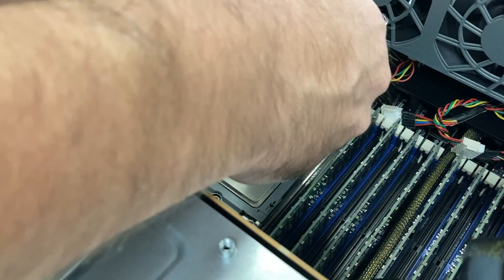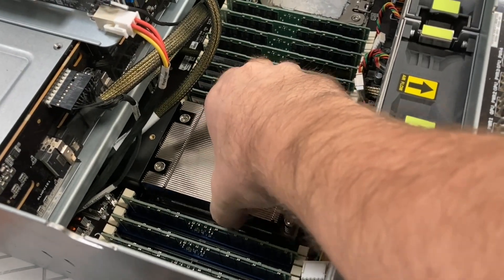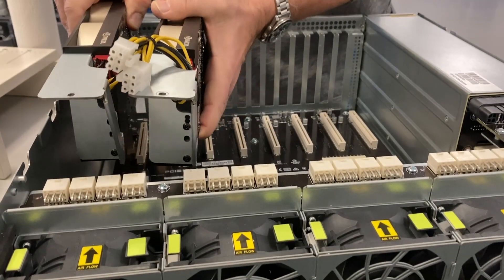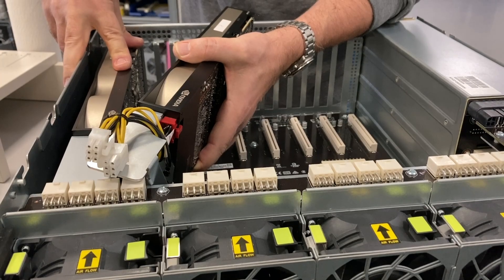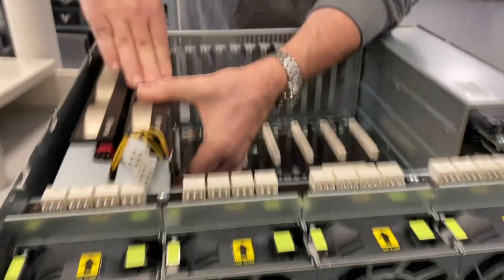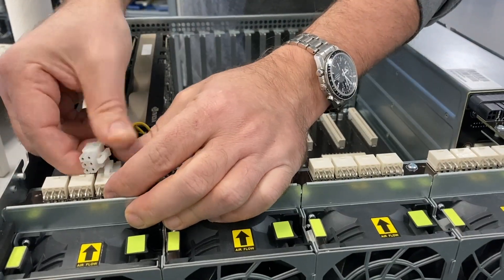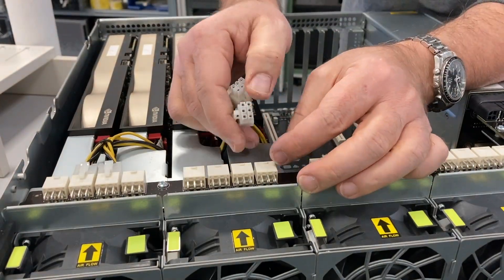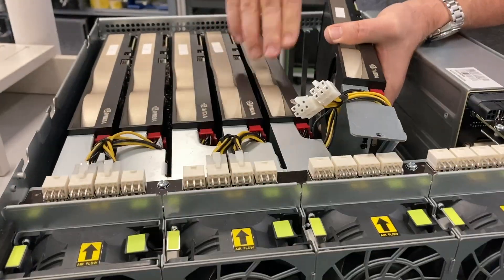Originally the CPUs had a little bit too much thermal grease on them, so I hope I'm doing it better right now. I also had to remove the entire PCI backplane here, because someone had nicked off one of the capacitors, eventually when installing the graphics cards for the first time. So I had to take that out — it's connected with cables to the mainboard, so I had to disconnect all the cables. And maybe that was also the cause of the problem, because sometimes these connections are not perfect, and disconnecting and reconnecting something may actually repair it.